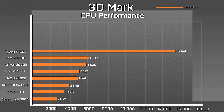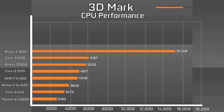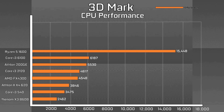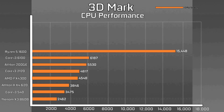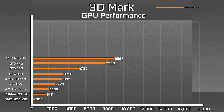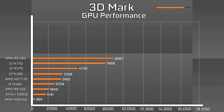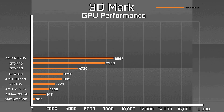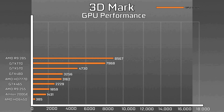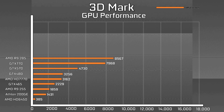To put the CPU and GPU into perspective compared to others: the Athlon 200GE CPU-wise performs ever so slightly worse than the Core i3-6100, which was virtually on par with the Pentium G4560 — good news in terms of competition with Intel in the low end. In terms of the GPU, the Vega 3 graphics comes in just slightly weaker than the R9 255, performing like an HD 7730 or GT 740 — not bad at this price point. If you want to add a small GPU down the line, I'd recommend something like an HD 7870 or RX 560 as a good pairing.